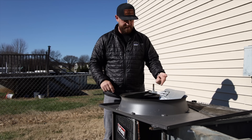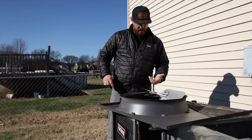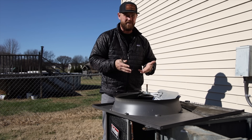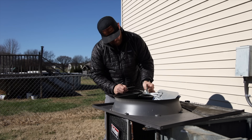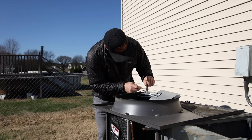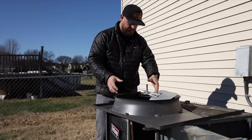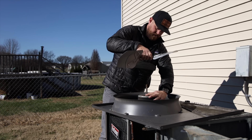What I was going to say before it actually slid down on its own — it's good to mark it on the shaft so that when we put the new motor in, we know exactly where that blade was and don't have to guess. I can see where it was because the shaft is nice and clean there, but I'm just going to take my knife and scribe a little mark so it can't be rubbed off. That way I can reference it whenever I put the new motor in.